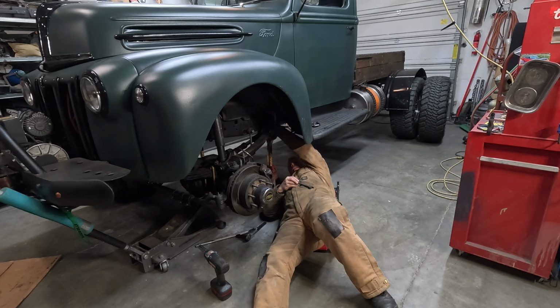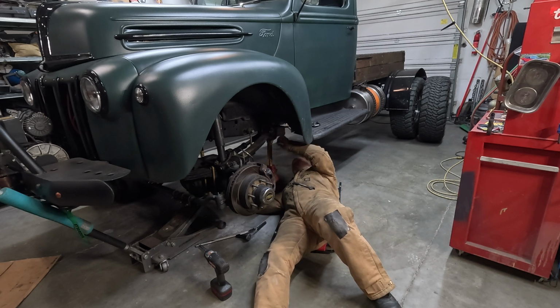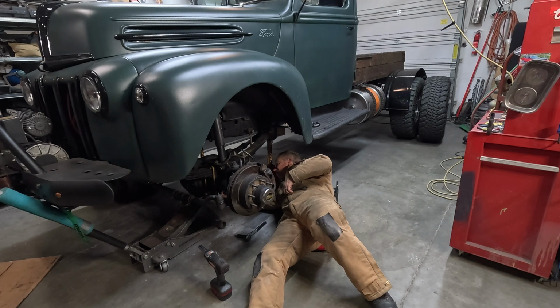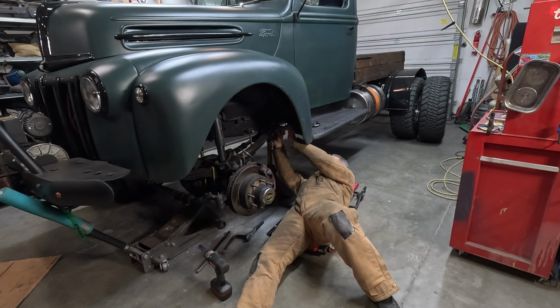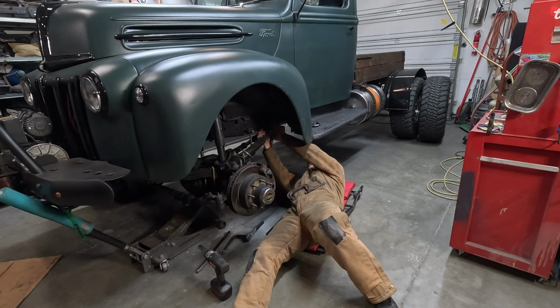That was nice. The clamp is keeping any tension that was in the shackle from having a catastrophic release, because you don't want that when you're underneath something. One of my washers disappeared, and I wanted to make sure I kept an eye on it, or I'd probably never find it again. All right, let's see how much this wanted to move over. Oh, only about ½ an inch, so we're good there. That worried me at first, though.